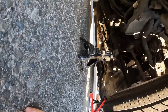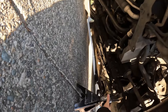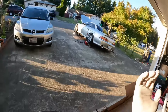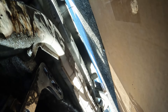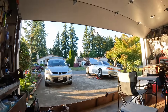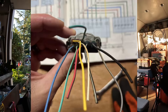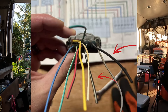I'm not putting the jack right in the middle because I'm working near there. It says yellow to red and black but I'm not sure about that. Doing some more research — looking up reverse lights for the manual swap. For a 92 to 96, I believe red and yellow are for reverse lights and it should be these two black ones for the neutral safety switch.